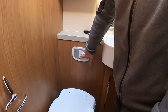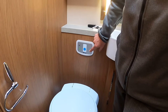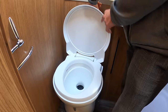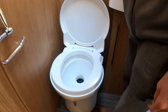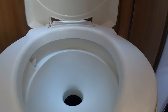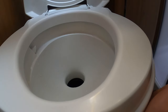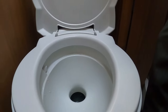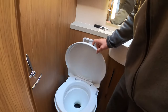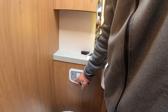To operate your toilet, press this button — that's your flush, but your ventilation fan will kick in. When it's flashing the fan is on; to switch the fan off, press it and it'll cut out, then press this and it'll flush your toilet — you'll hear the pump kick in in your garage behind the toilet. You've got a slide here which closes the trap door; if you slide it right it opens the cassette, but it must be closed to remove the cassette from the exterior of the vehicle, otherwise it won't come out. The indicator will show red when the cassette needs to be taken out and replenished with chemical.